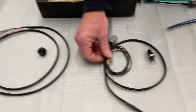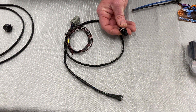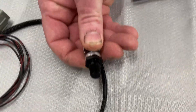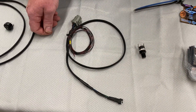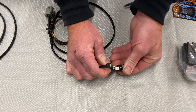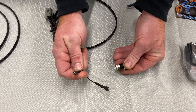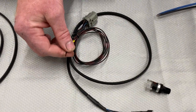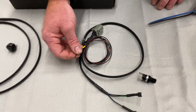This other setup is for use with a temperature switch. You're going to install this into maybe the radiator or potentially your thermostat housing — it's 1/8-inch NPT. We have different set temperatures, and that's going to plug in right here. This is the same thing — it's ground triggered. This is actually ground, and these are what's going to turn the fans on. You're going to make sure that this is ignition-powered but only with the key on. That way it prevents the fan from running when the vehicle's turned off.